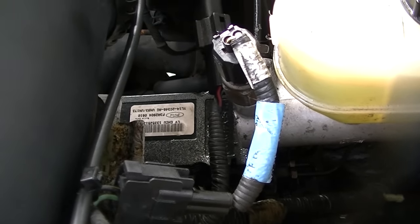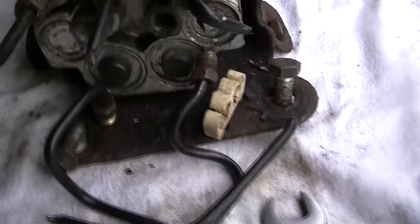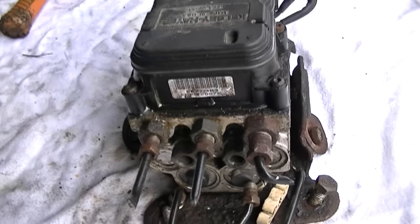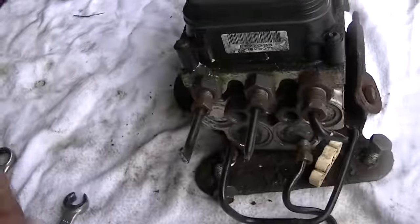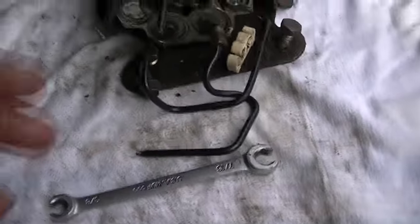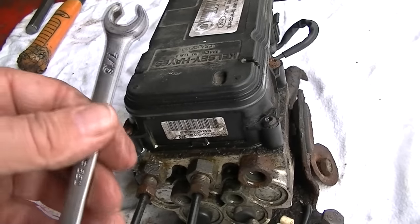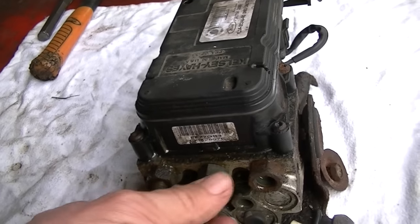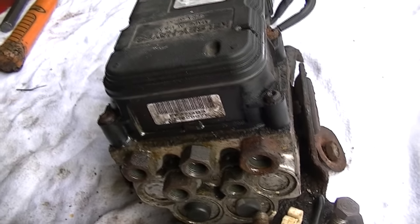Once you get beyond that, you can get down into the ABS pump and start taking it apart. Here is my old pump set up on a cloth. The two brake lines from the master cylinder go in the bottom, and I've got a couple of old ones here just for video purposes. When you start, first thing you want to do is take the three lines off on the top. This particular line is a half inch — don't use a regular wrench. The second one is a 7/16 — make sure you get a good brake wrench on there. It may be a little rusty but work it back and forth and it will clean off. Take that out, then do the same for the remaining lines, including the two on the bottom going into the master cylinder.